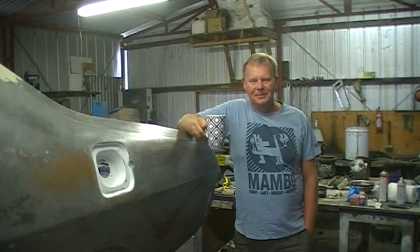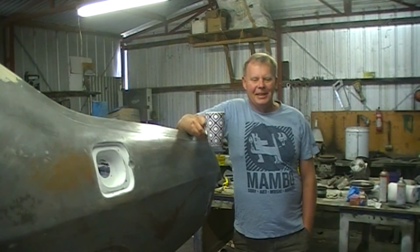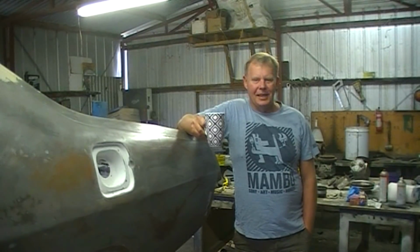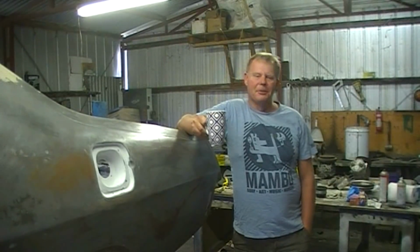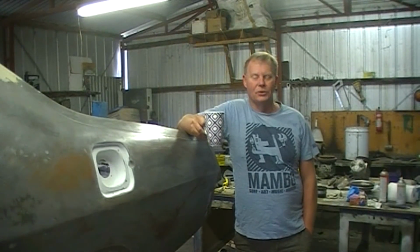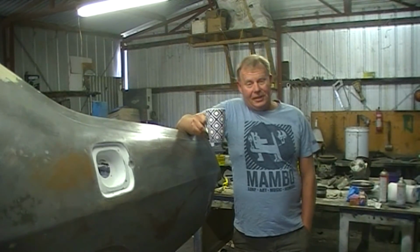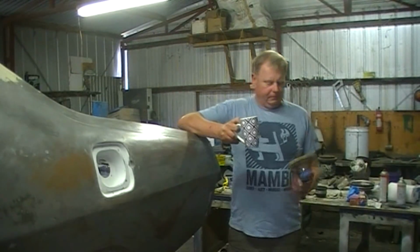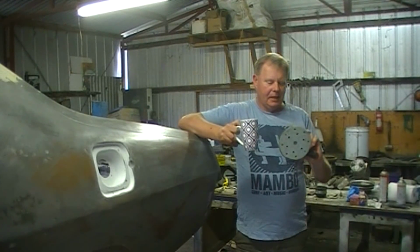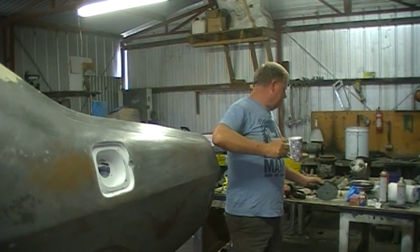The reason why I'm doing sandblasting at 2 in the morning is because I just bought a brand new compressor yesterday, and whilst it's not a monster, it's a triple pump. It's got about a 100-litre tank on it, and I plumbed my old compressor, which has about a 50-litre tank, into it as well, so I've got about 150 litres of storage. And having a triple pump, it actually keeps up, especially with the sandblaster. Even these little air tools, they drink the air as well. I couldn't run that sander with the old compressor, but jeepers, it never runs out with the new one.